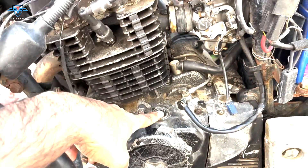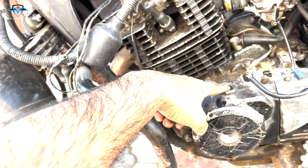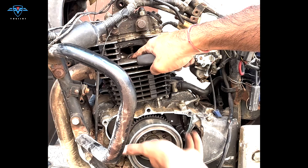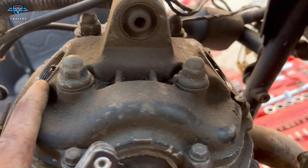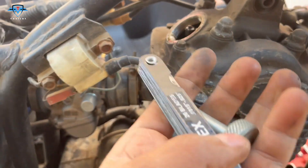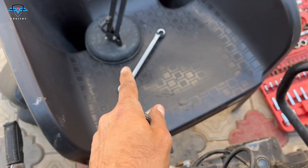There's another catch here — the piston is on top twice in a four-stroke engine, so the compression stroke is when you feel this pressure. That means this is the intake side valve and this is the exhaust side valve. So now you need these tools to adjust the valve clearance: one is this ring spanner.